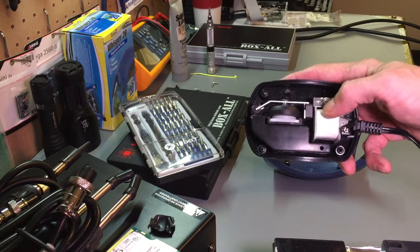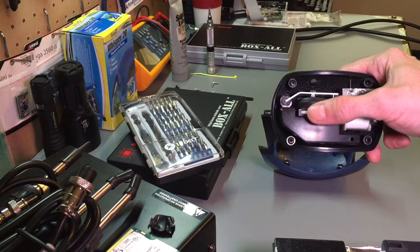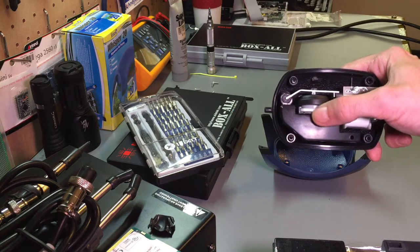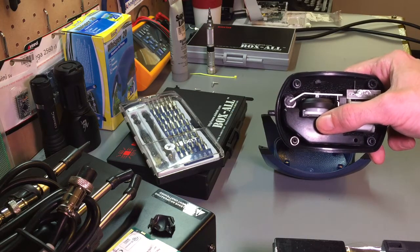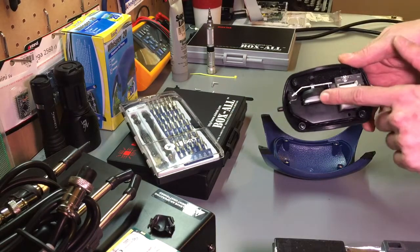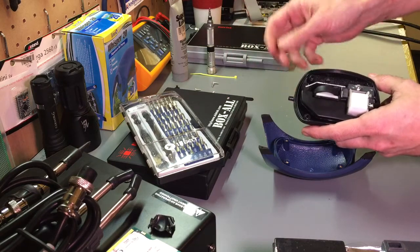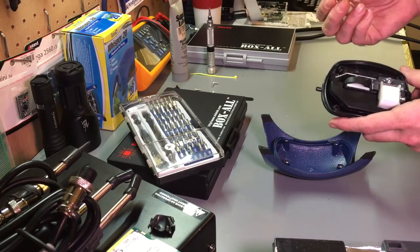There's a transformer releasing a magnetic pulse with another magnet that operates the diaphragm — bouncing up and down — and controls the valve to open and shut a certain way, controlling the airflow. What we're going to do is turn this valve around, so instead of putting air out, we're going to suck the air in to pick up little SMD components and parts.